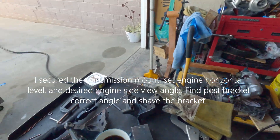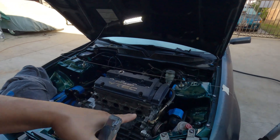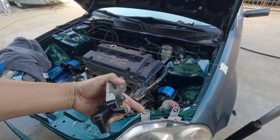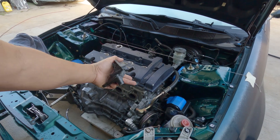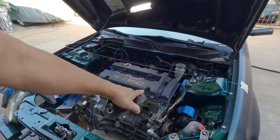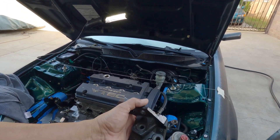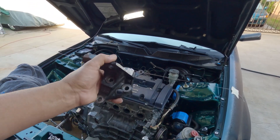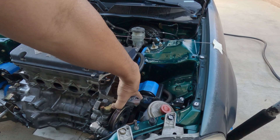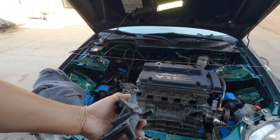This is what I've come up with so far. I'm just reusing the F23 bracket — rather than making a new bracket I just modified this one. It can go up or down to my desired engine height. Earlier I thought I had it made, but I have clearance issues now. Once everything is bolted down I'll see — I don't want to react now because it's not done yet. Once it's secured I'll just create another hole and bring it down, and add a spacer on that mount, maybe about an eighth of an inch.